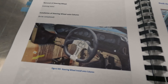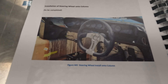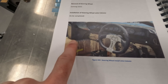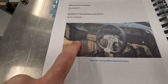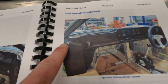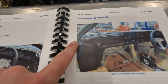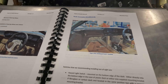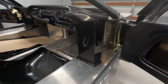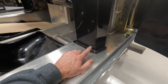These are pretty much the only two images I was able to find in the build manual that give any visual guide as to how the dash sits in the vehicle. One thing I'm picking up is that there is no foot on the bottom of the dash — it seems to have been trimmed. Looking at the other image, there's obviously been a bit of the dash trimmed to tie in with that pillar, but it doesn't seem to be anywhere near as much as what's indicated on the dash I've received.